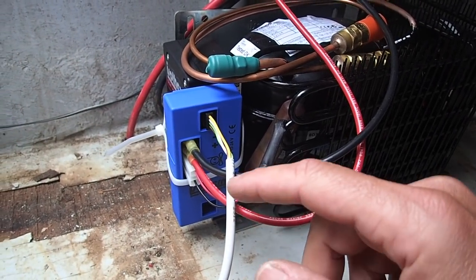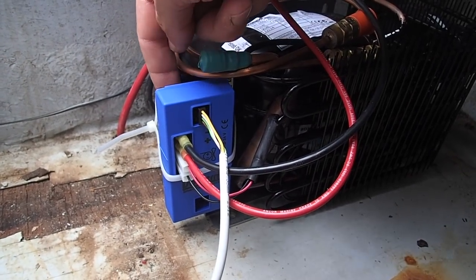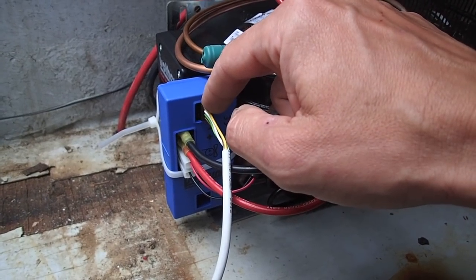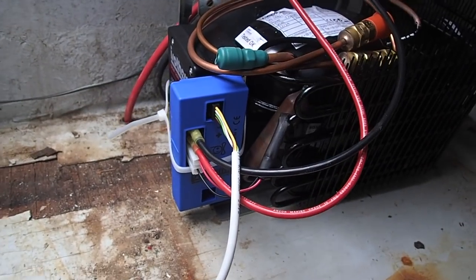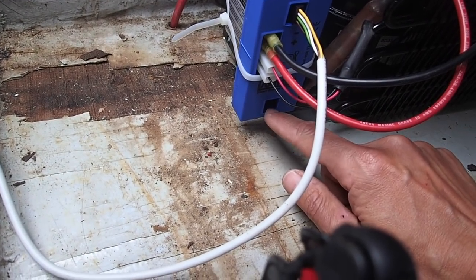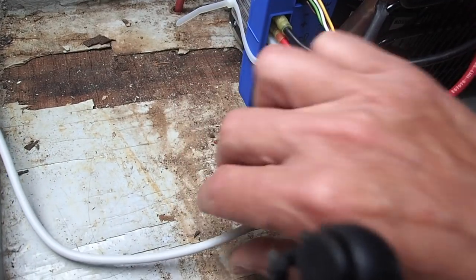We've got all the wires set up here. The bottom ones are the fan wires that you will have pulled out from the sockets before you put the blue one on. These two larger ones are our power. Right here is some of the control from the thermostat, and this one runs down and into the fridge unit itself. We'll come back here and talk about the dip switch settings, and we'll also clean all this up and secure our wires a little bit more.